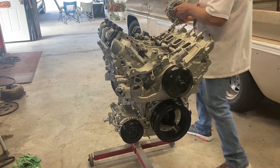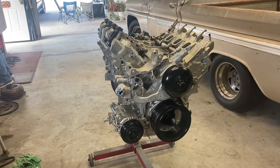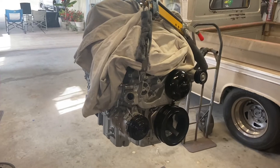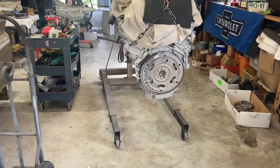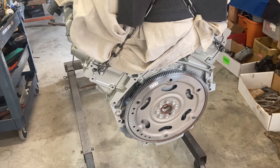I'm going to put this stuff back together. Got the front back on — wasn't that bad. It's the first one I've done. You got two little extra parts, but I take it apart, I can put it back together. So we got the intake on. We have to change this flywheel out. I got the torque converter already put in the transmission. So while we got it hanging, we're going to change the flywheel and then get the transmission put on, then we'll be ready to get this one sent down the street.